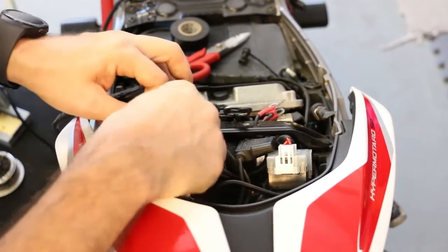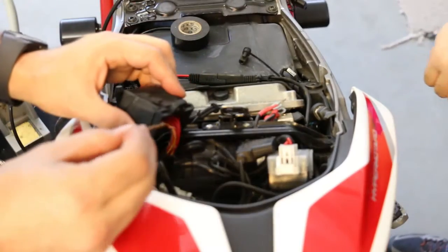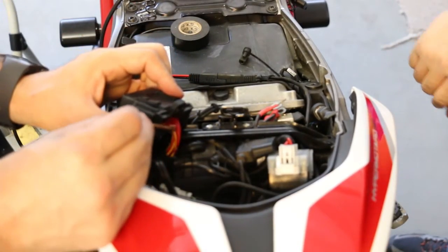Now we're going to wire the GPS ignition wire into the key sensor fuse wire. The reason we only have one wire here is because the ground wire is shared with the OBD plug.